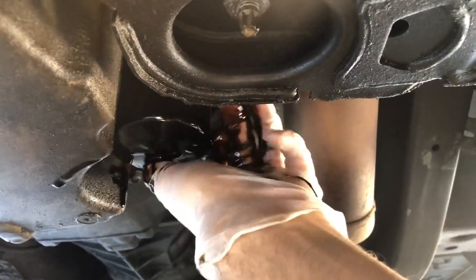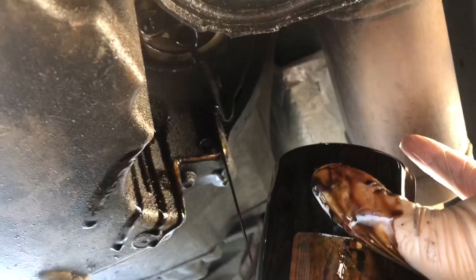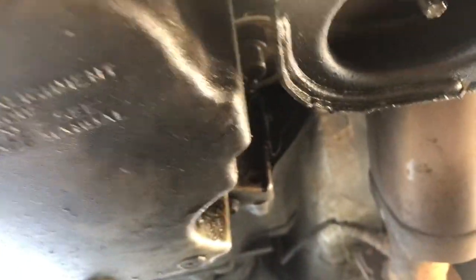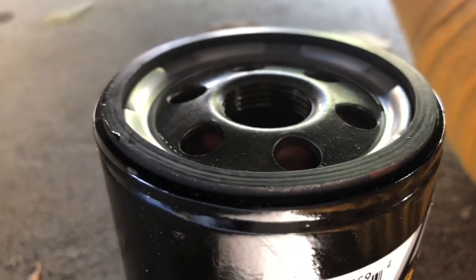Make sure you wear gloves because you don't want oil on your hands. Go ahead and catch it — there we go, a little bit more oil comes out. Same thing, just wait for that to drain — it's only a little bit of oil. One thing I forgot to mention: when you take off the old filter, make sure there's no black o-ring left on the engine. If it's still on there you have to take it off, or else you're going to have a major oil leak. This black o-ring right here — that's what it looks like.